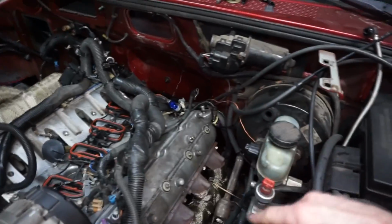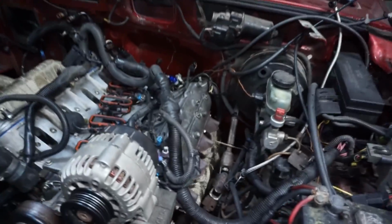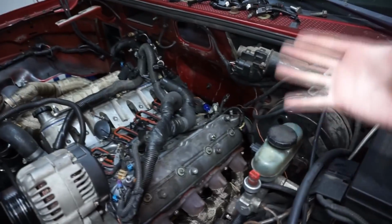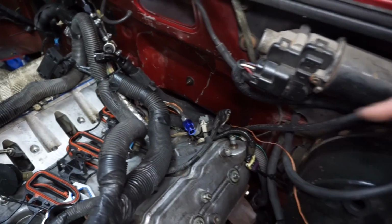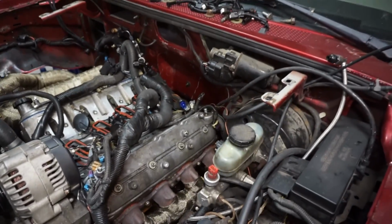So I was using this little hose before, just on one of the critical firewall spots, but I decided to take that off and then run a hose all the way from the fuel rail down to where my pressure regulator is. So that thing's completely protected now. I kind of got hung up for probably a half hour doing that stuff. That was kind of difficult, because when I normally do it and I have the transmission out, I'll put all the hoses up, and then I'll put the trans in, and it pushes everything up where it needs to be. But this, I had it laying underneath the truck, and then I tried to push it up from the bottom, and that was a little bit challenging because it was getting hung up on the firewall and stuff. So that took a while.